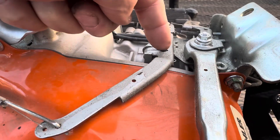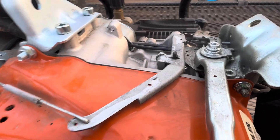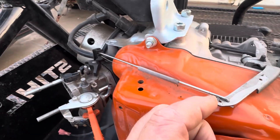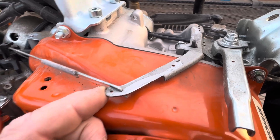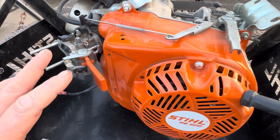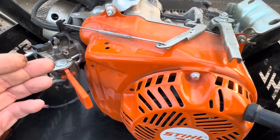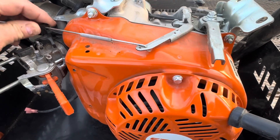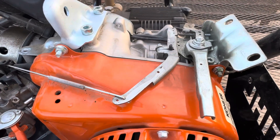This center shaft is constantly being manipulated back and forth as engine speed or engine load changes — that's how you maintain this arm in relationship to the carburetor at a constant RPM, like 3200 or 3400 on a power washer and 3750 on a generator. My main point for this video is to show you how to get your preliminary adjustment for just about any engine with a governor, whether it be a horizontal engine like this or a 1970 Briggs and Stratton single-cylinder vertical motor — the procedure is all the same.